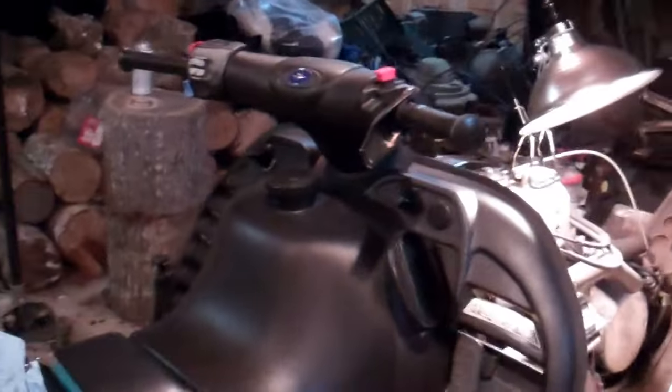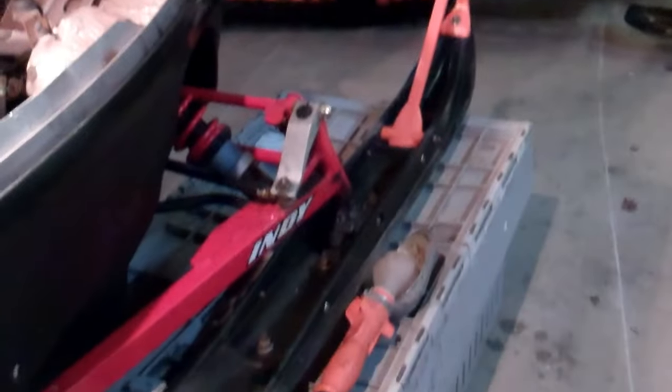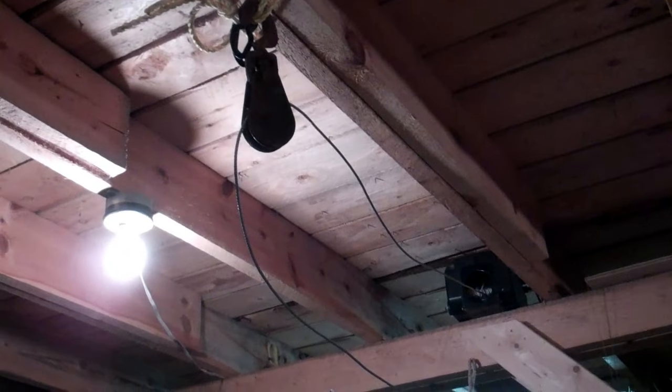I've watched several YouTube videos and read many snowmobile forums. I have to remove or loosen the bogey wheels and those adjusters, and then I've got to take out these four carriage bolts to remove the undercarriage. I put it up on these lobster crates to get started.